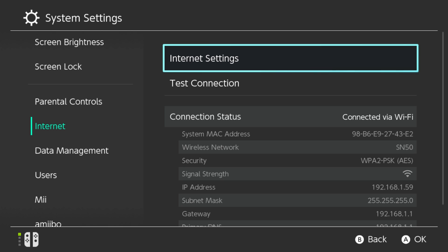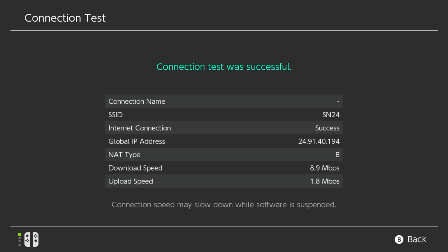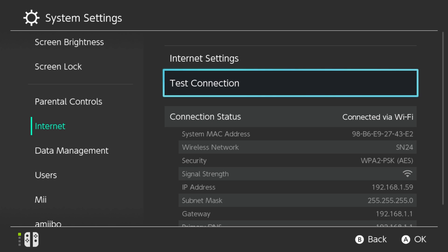In this testing, I've done on 2.4 gigahertz, 5 gigahertz, and wired connection as well. Let's first start off with 2.4 gigahertz, the most common connection that most of us will connect with. After doing the test connection for speed, you'll see that on 2.4 gigahertz, you only get 9 down and about 2 megabits up. That's relatively slow considering my connection is on 175-180 megabits or so on the download and about 25 on the upload. So you're really not getting a lot of speed on 2.4, and this is the most common that most people connect to, so that's something to definitely be aware of.